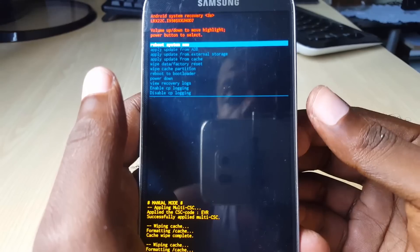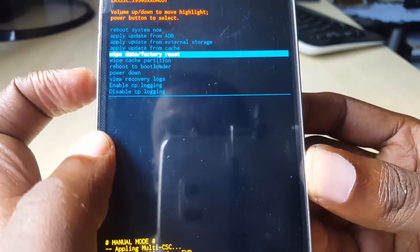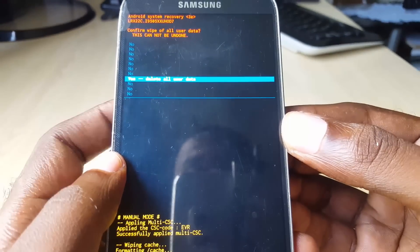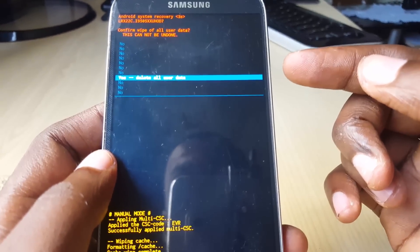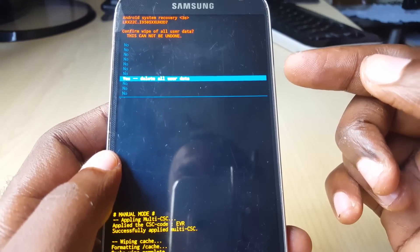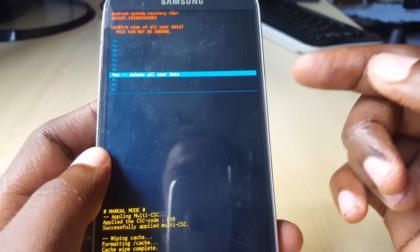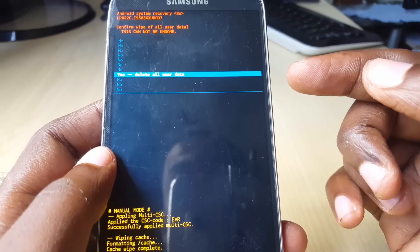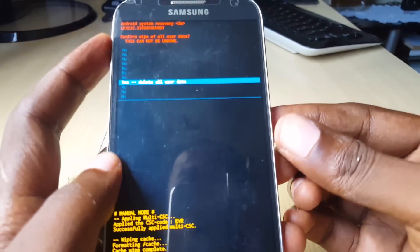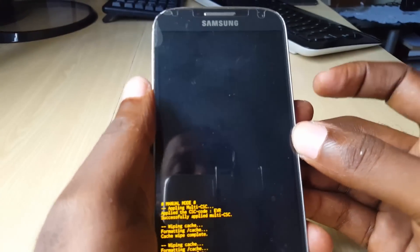For most of you, the system will boot up after that. If it still fails, go back into recovery mode, scroll down to 'Wipe and Factory Reset', press power to select, and then navigate all the way down to 'Yes'. Please know that this will erase all of your data. In some cases this is the only way to get the device booting again. If you don't want to lose data, skip this step — it's not guaranteed to fix it either way.